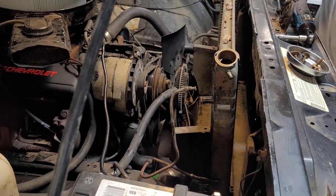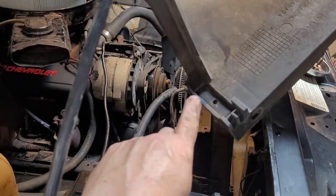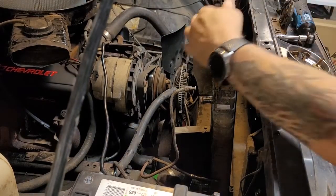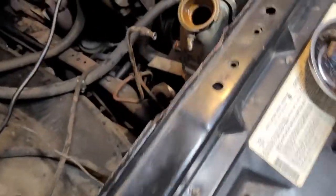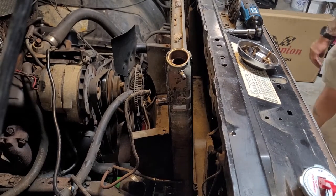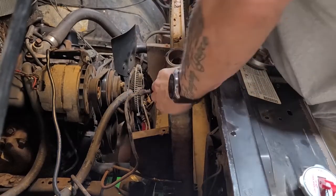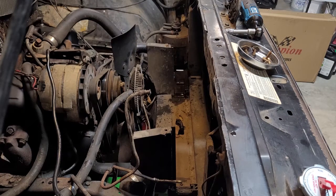Pull the top off and I'm correct — folks, if you look right here there should be a rubber insert with a little tab on it that goes through this hole to hold it in place, and then it sits on the shoulder of the radiator. That holds and insulates the radiator from vibration and holds it in place. Those are missing on this truck, so we will need to acquire a set of those before we finish this job. We can now lift the radiator out carefully since it's still got water in it, and carry it out to finish emptying it — trying not to make more of a mess than we already have.